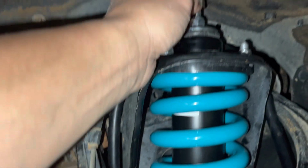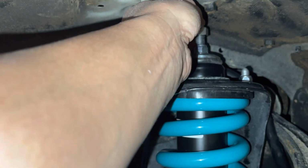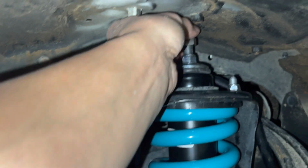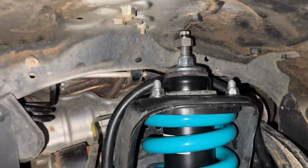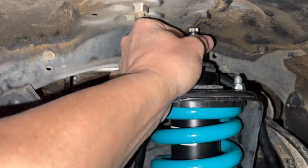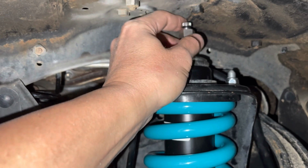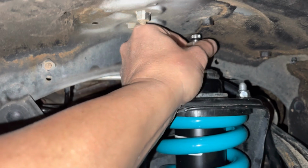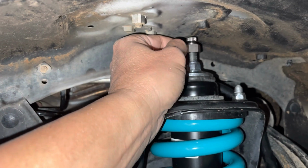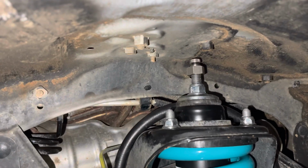Okay. Now, once that gets some pressure on it, and you're going to turn, it's just like setting the Rebound on your rear shocks. You count the clicks. I think they've got a breakdown in the book. I just can't remember. It seems like 3 full revolutions is a total of 18 clicks or something like that. But anyway, that's what that's going to look like installed.